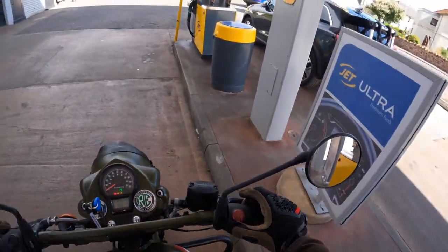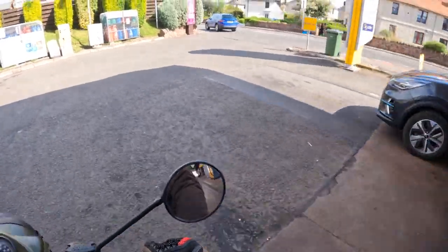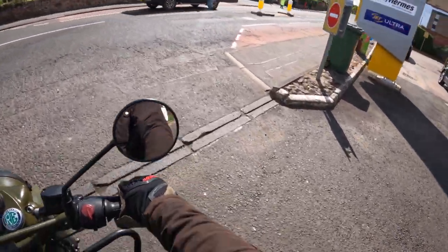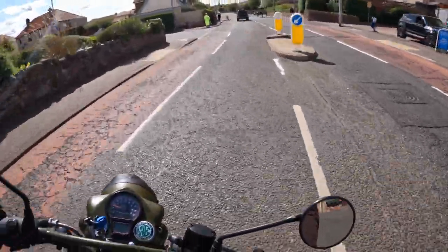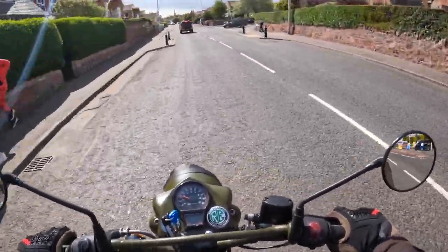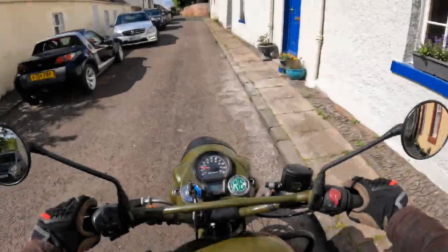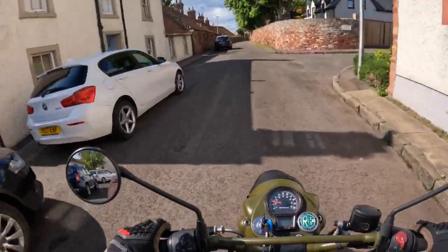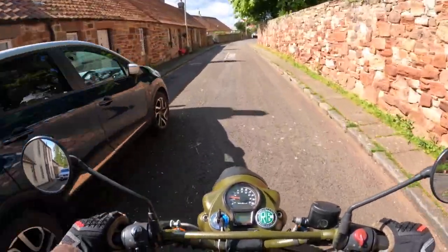So anyway, take the bike down around town, no one behind me, and just drag the brakes for a few seconds at a time and just break the pads in. With mountain bikes, what we do is we actually squirt water on them and it breaks them in a lot quicker. So I guess if you went out in the rain and did it, it'd be the same. But anyway, there's not much footage for the rear pads, sorry. But that's all there is to it, really.